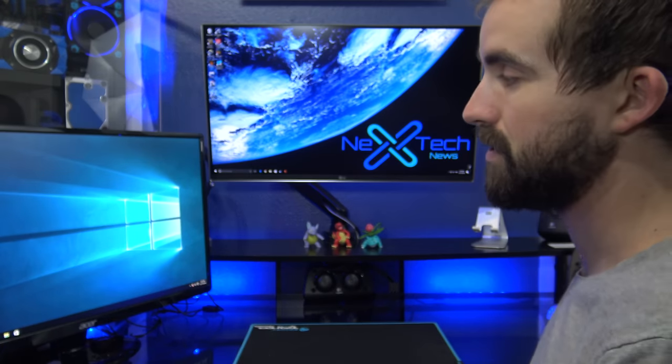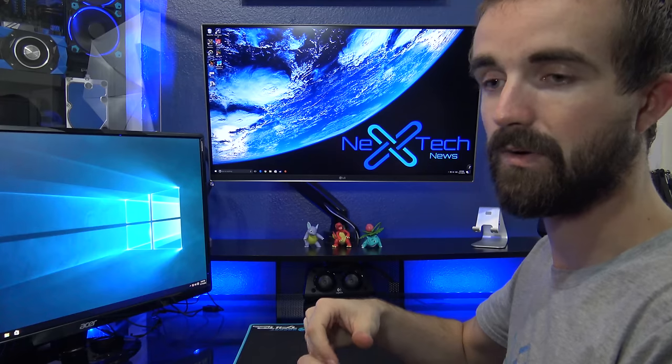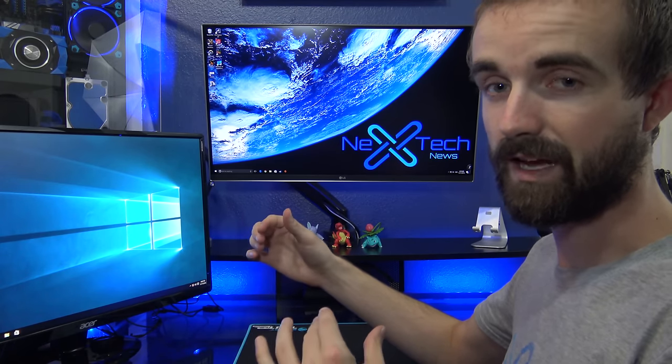So now I'm gonna download all the drivers I need, and then I wanna make sure and do a stress test on the CPU to make sure that the power supply that's in there actually can handle that CPU. If I have to, the reason I chose the i5-6600K was so that I could underclock it if I need to meet the power requirements.